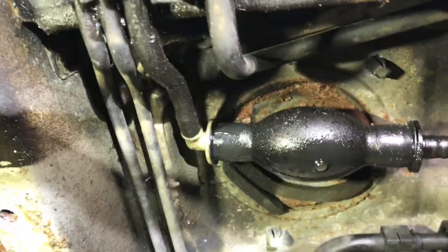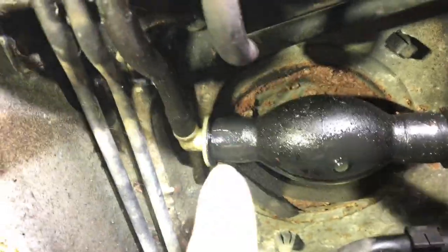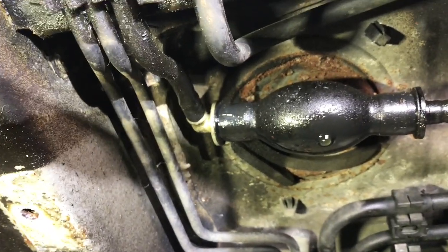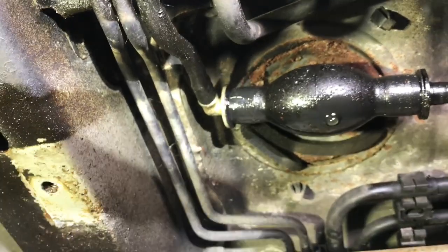And we're underneath the machine, so you can see there. Diesel wetness. Roddy found it. Up there's a crack in the bulb. So that's what had been our problem. We kind of suspected that anyway, air in the diesel, so we'll need to order that from the dealer.